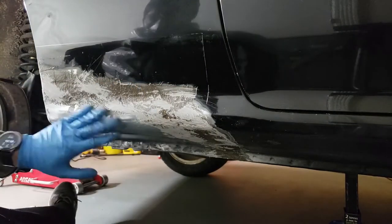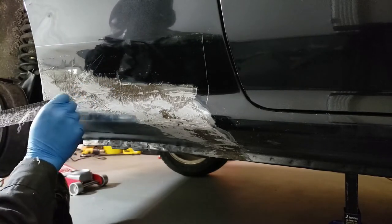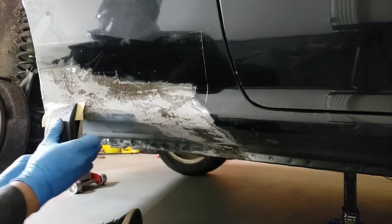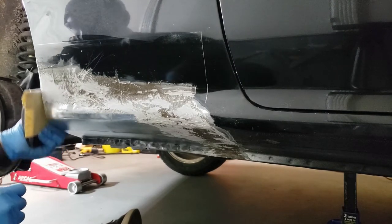After cheese grating, let it fully cure before sanding. Now sand with 80 grit with a sanding block to blend it to the surface. Don't worry about the low spots — we'll be filling those in with regular body filler.